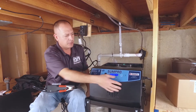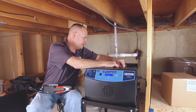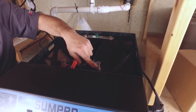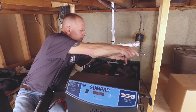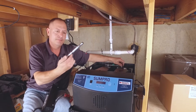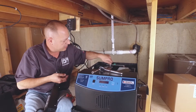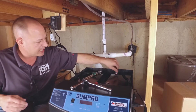What we'll do is disconnect the SumpPro and silence it to get the power off. I always put the bolts back in somewhat because the nubs on top of these batteries aren't that high, so it might be hard to clamp the tester ends onto them. One thing to note when disconnecting batteries: this end should be rubberized in case it makes contact. Try not to make contact between the negative and positive on one battery because it could send out a spark — it could actually weld the socket wrench to the battery.